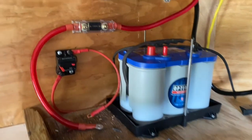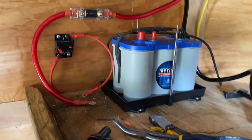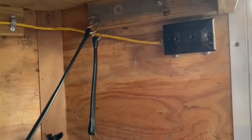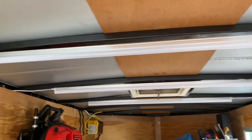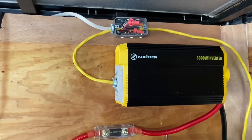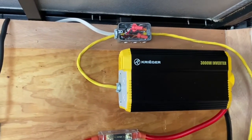We're going to install the negative side first — whenever you're hooking up a battery, set up the negative side first. We've nearly completed everything: the outlet, the switches, the junction box, the inverter — everything is connected, all back to the battery. Then we tie the battery together: start with the negative side, put it on, then the positive side. We tested it and everything worked fantastic. This inverter came with a control switch that plugs into the back, giving you plenty of wire to place it anywhere in the trailer. Once that was hooked up, everything worked perfectly.